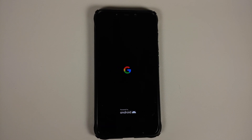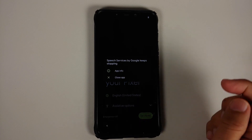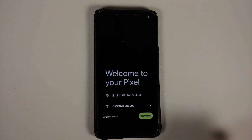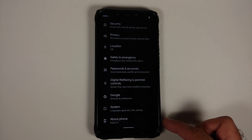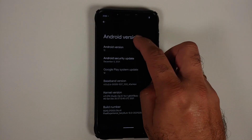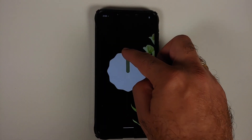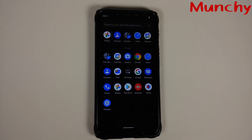Once that is done, tap the home button, go to Reboot, select System. We now have the Google boot animation on our Poco F1, which means we are booting into the official build of Pixel Experience based on Android 12. The first boot may take some time so be patient. We are on the setup screen — speech services is crashing, just close the application. After skipping the initial setup, here we are on the home screen. Going into Settings, About Phone — tap on Android version — Android 12, confirmed. Pixel Experience is successfully installed on the Poco F1.